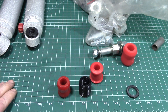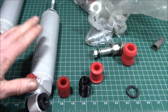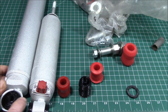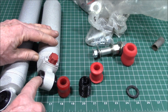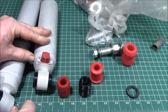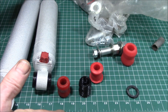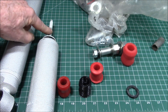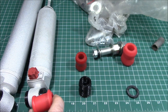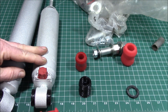A friend of mine has a Mazda B2600 4x4 pickup, and it turns out Rancho used to make shocks specific for that vehicle — this was the front shock, this is the rear. I'll post the part numbers in the video description. They made custom bushings for the shocks to fit the Mazda shock mounts, but now they've discontinued that specific shock. They still have the same length shock with a straight eye on the bottom and pin mount on the top — everything's the same except they ship it with that bushing, and the Mazda shock mount is a little bit wider.